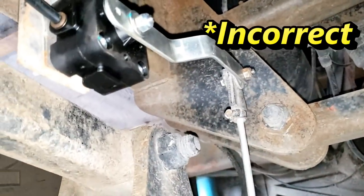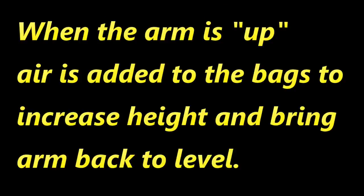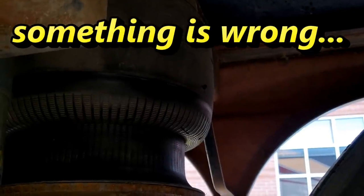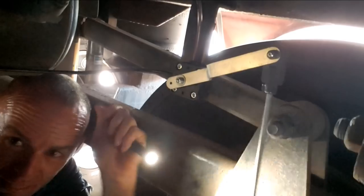So we go up with it — it needs to lower the airbags in order to make this arm go level. All right, on careful review, I think something else is wrong. They can let air out, but I can't put air back in the airbags, and doing that wasn't affecting the airbags at all.